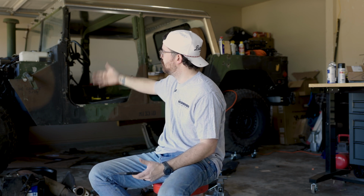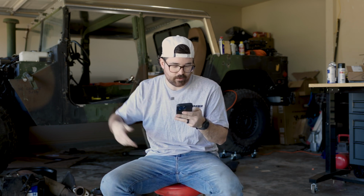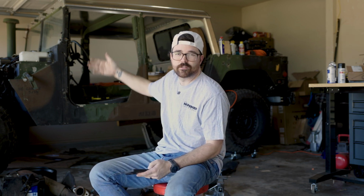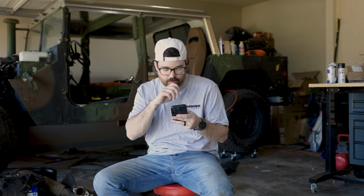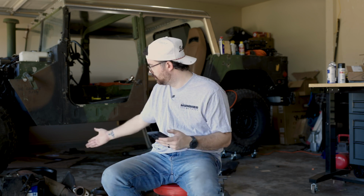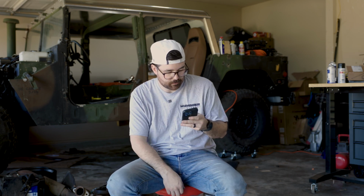Obviously, I need to build something to kind of go up the sides so the air is forced in, make sure I have a good gasket seal, make sure the rubber seals force air into the radiator. I think I can just trim some aluminum. People make panels that bolt on the side and go up, so I feel like I can make that. May benefit from a different thermostat crossover, maybe. He said, absolutely don't get rid of your fan clutch parts, so I have them sitting in the pile. Oh, he also mentioned the blue Hummer lock nuts.